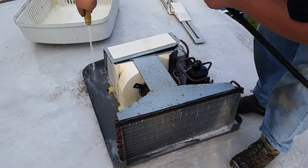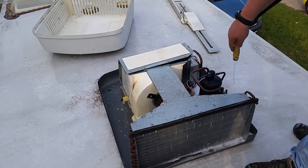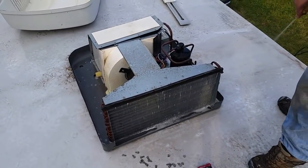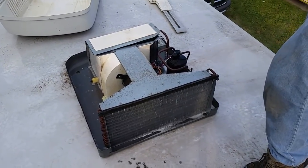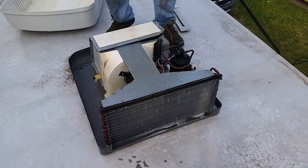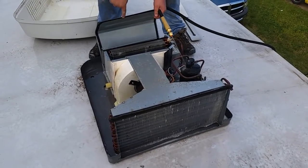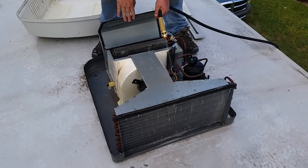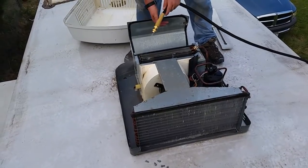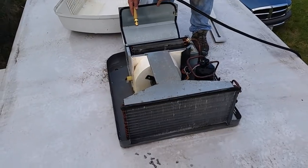The condenser coil is the easy part — that's the outside coil — because it just pretty easily drains out and most of the stuff is fairly spray-down tolerant. Because the inside coil is going to be tricky, because your cold air output into the rest of your RV is right down through here. So you've got to be careful where you're spraying.